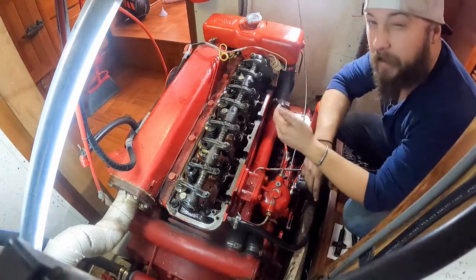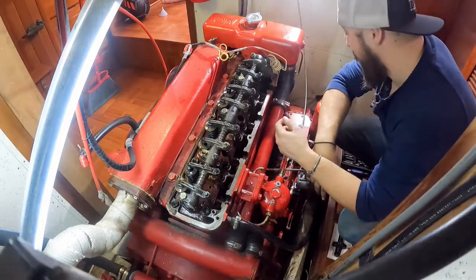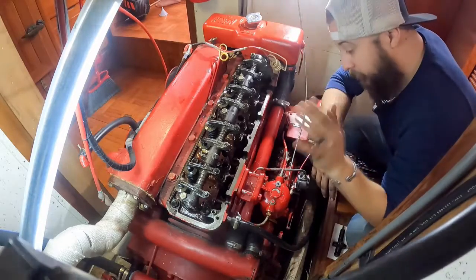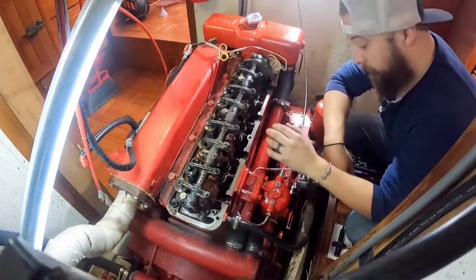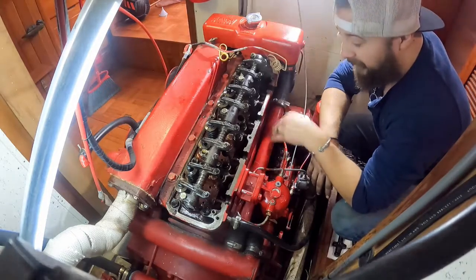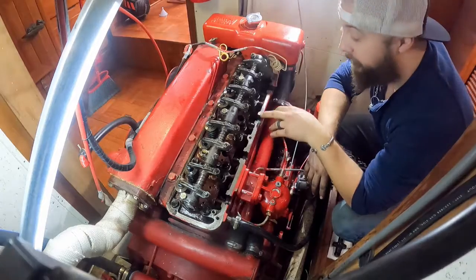The previous owners were probably running this one with the water, which is causing some issues, and someone's definitely been moving around in here chasing a problem. Long story short, I'm going to go through, check all the lines, start fresh with good lines. The pump seems good now. Get the injectors sent off, and after that we should have a tight sealed system with good flowing injectors — and hopefully you guys don't see me back in here anytime soon.